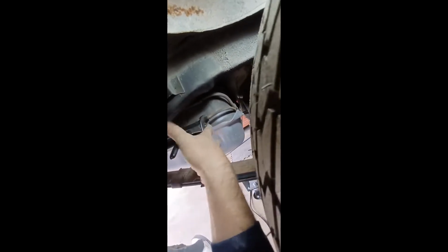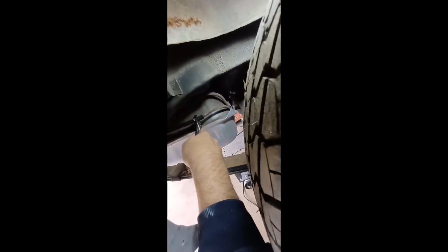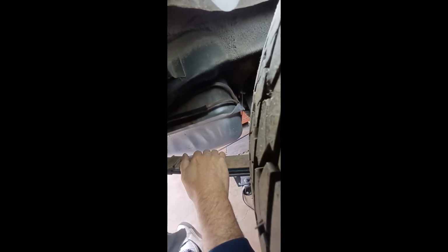So basically this car sat for, I don't know, 16 or 17 years, I'm being told. I drained all the fuel that was in it the best I could. I think I got it all but maybe a gallon. After that, I put new fresh gas in it. We rebuilt the carburetor, and she started up and was running good after I'd done all the work to the engine. I had to put a timing chain on it, and new plugs, new wires, a bunch of new stuff. If you watch some of my other videos, you can catch up. We got it running, and it ran good for maybe 10, 15 starts. We never ran it long, 2 minutes here, 3 or 4 minutes there, and it ran pretty good.